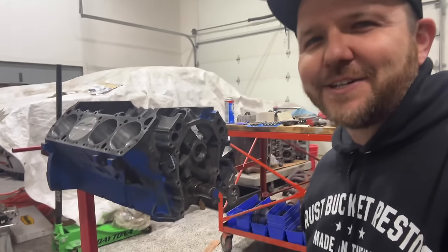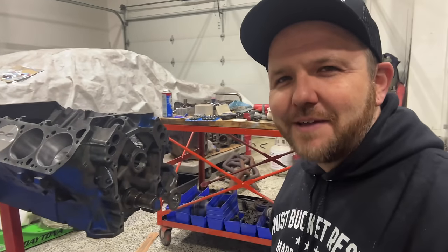All right, so we got our last piston installed. I also went ahead and installed the Melling M63 high volume oil pump, as well as the fuel block off plate here, because we are gonna be running an Aeromotive electric fuel pump system on the car. So time to shift gears a little bit and start installing our camshaft and our timing gears.